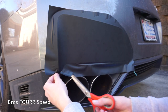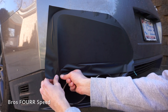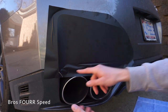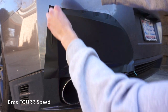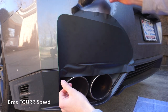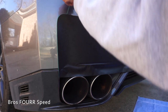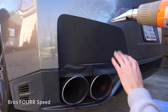Just to help get me started with this film, I'm also going to cut just a little line in the vinyl to help make this thing come out perfectly. You can see the filament is already through the vinyl. Giving it a tug, we're cutting a perfect line here. All the bubbles are out, everything is nice and clean. We're going to pull the filament all the way out, cutting a perfect line on the vinyl — you want to do this with one clean motion. Then grab the green and pull both pieces out.